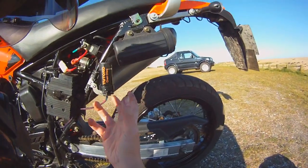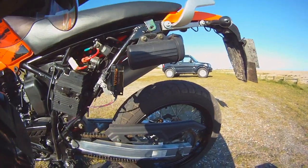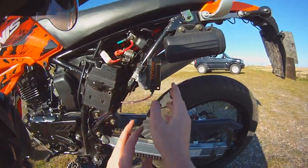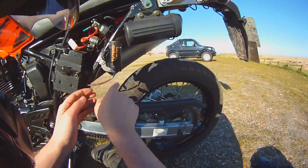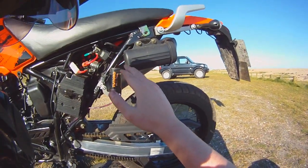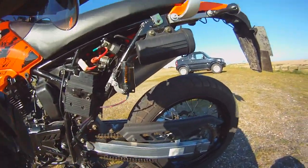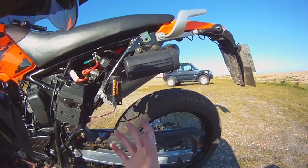Build quality is fantastic — the bracket is really good and strong, and the plastic the oiler itself is made from is high-density and feels quality. The first thing I noticed when I got it out of the bag was that it's a really nicely made bit of kit, especially coming from a family-run business. In the kit you also get a lot of plastic tubing — miles of it — so you roughly get everything in the right place, tie-wrap it down, neaten it up, and chop the hose so there's a little give for any movement. One thing you must never do is mount it on the swing arm itself, because the rattling would chuck all the oil out.